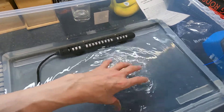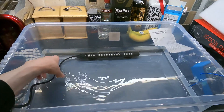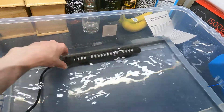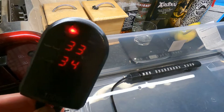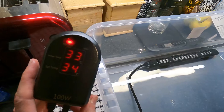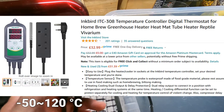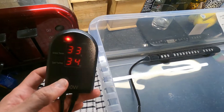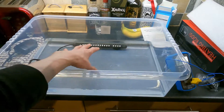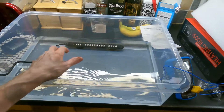So there it is — this video was just a giant tub of slightly warm water, but it's proving the point that I can use one of these aquarium heaters to do some retrobrite and speed up the process by just heating the water a bit. I'll link in the description what this is and how much it costs. I bought it specifically because it's an all-in-one thermostat and heater, it's quite cheap, and it goes up to 34 — that seemed to be the easiest way to get some heat into water without going completely overboard. In the next video I'll probably try and retrobrite the keys from the A1200 with this method — I'll heat up this water, put the keys in a tub or bag inside, and let the hydrogen peroxide do its work, maybe with a UV lamp over the top as well.